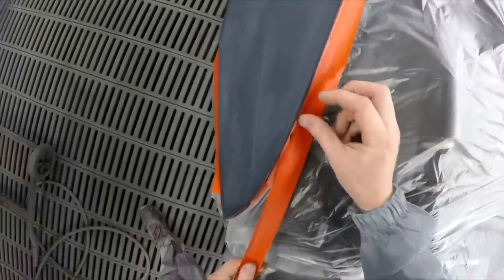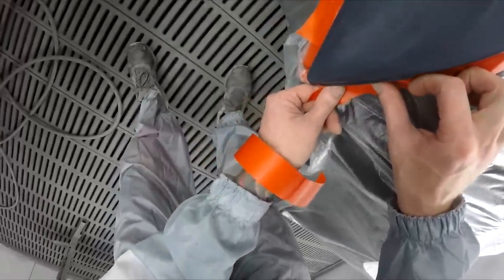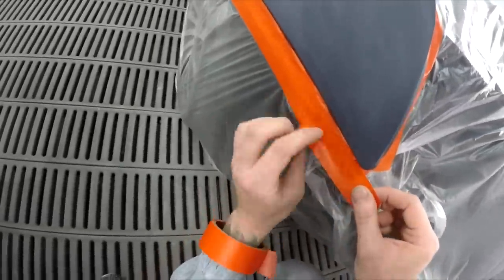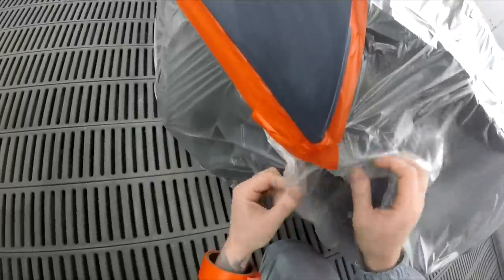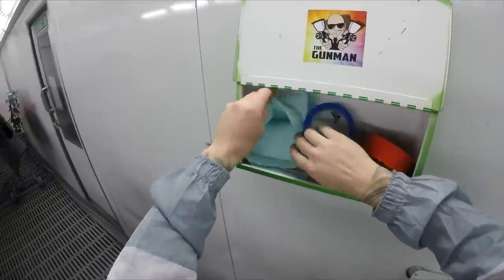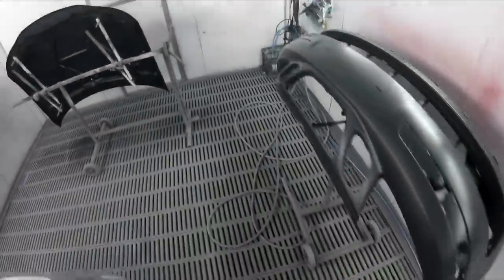So I'm going to come in with two guns. First I'll go out and clean out that wet-on-wet gun, then I'll get one gun with the hardened base coat for the inside of the bonnet, and I'm just going to put one nice wet coat over that dark-coloured wet-on-wet — that's all that's going to need. And I'm still using the DV1 HVLP 1.3 at the moment and I've been enjoying that.